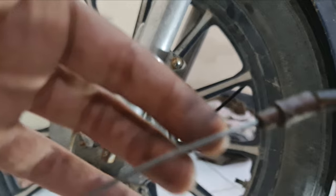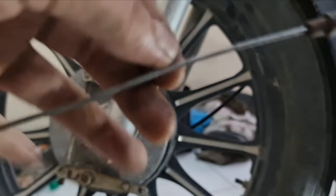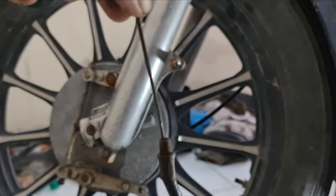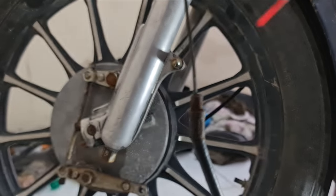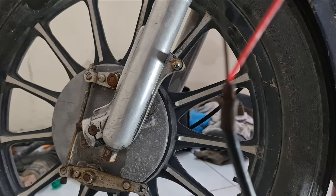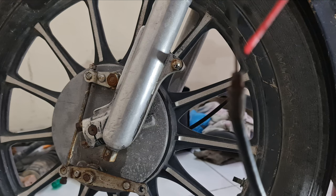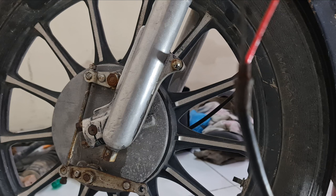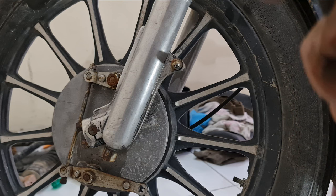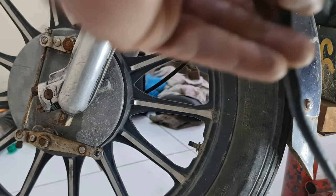Let's check if this can be reused. There is no rust and no wires breaking — that's good. Now, a lot of people suggest putting oil in — trust me, it does not work in the long run. It just accumulates more dirt and grit and that makes the wire worse. Do not use oil. You can use graphite — pencil lead broken up — but WD-40 is best rather than oil or any anti-rusting agent.